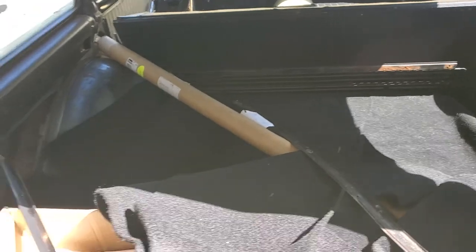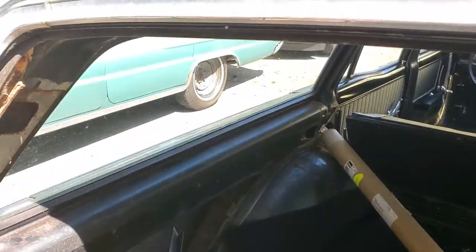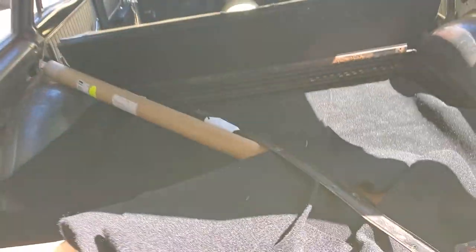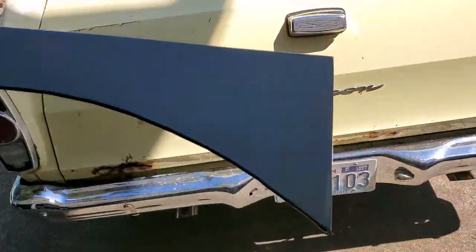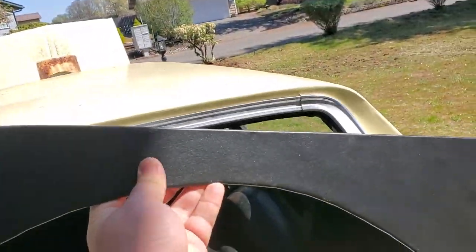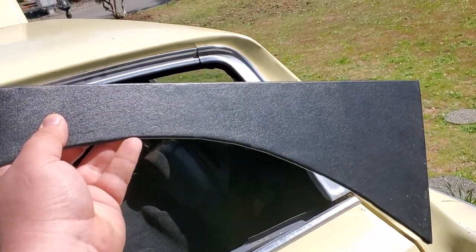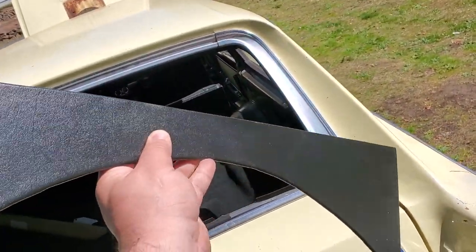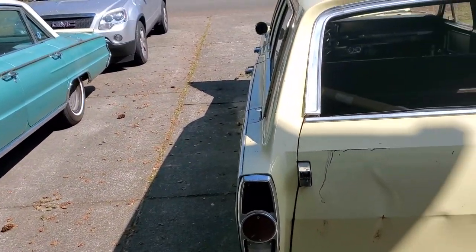It's not finished yet — the edges need to be trimmed and glued down. I have the side pieces that cover the fender wells. I remade them because they were all warped and just a cardboard material. I made them a little bit nicer out of fiberboard material, then wrapped them in a marine-grade vinyl that is UV protected. That rear cargo area will look real nice.